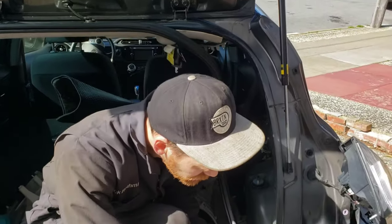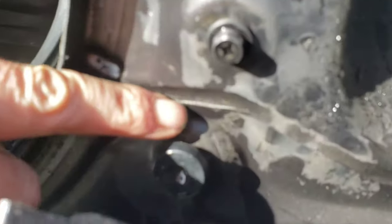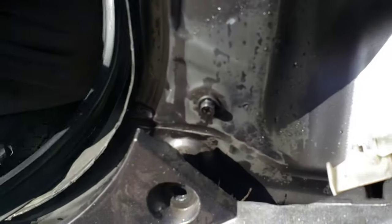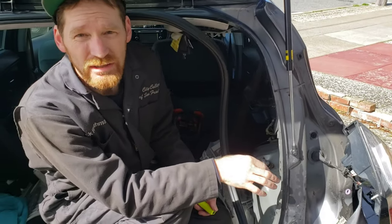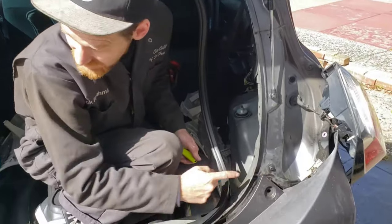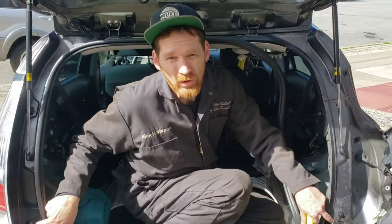We found the source of the leak. It's this little crack right here — a seam in two pieces of sheet metal — and water just pours into the interior when we pour water along this crack. My theory is this car was hit in the back, it was repaired, and I see various small clues of the repair including drippy paint on the hatch and odd spot welds. The fact the car's been repaired is fine, but we need to finish the repair and seal the leaks. This same leak exists on both sides, and that appears to be the main and maybe only source of leak.